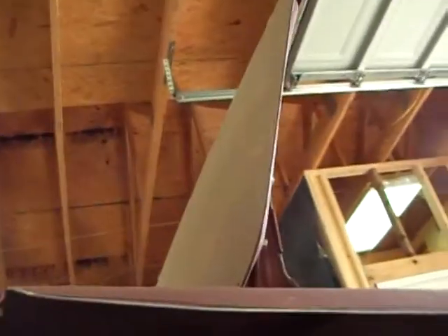Another thing I noticed about this piece is the new pieces don't come with these in there. Same with this under here. There's a brace under there. The new panels don't come with that, so I'm going to have to take that brace off and put it on the new panel. It looks like they bonded that with some kind of panel adhesive or something. I'll have to figure out what they bonded that up in there with, and I don't know if it's necessary. It seems like it helps with the rigidity of that panel, and why they don't put that in the new aftermarket parts — I don't know, other than cost savings — but I've got to figure out how I'm going to get that off and attach it to the other one.